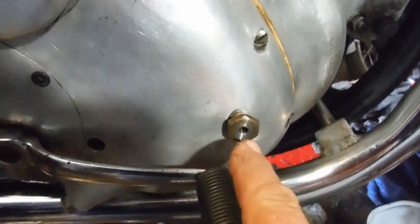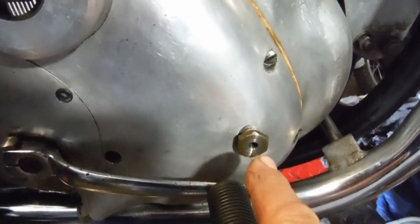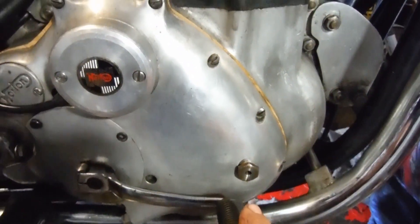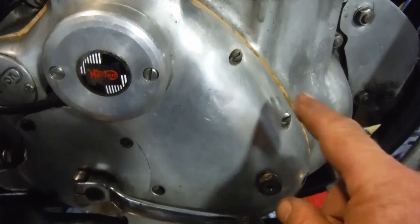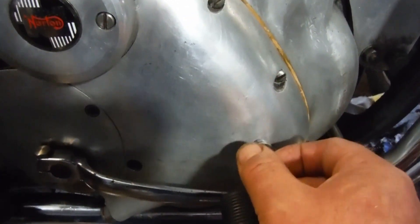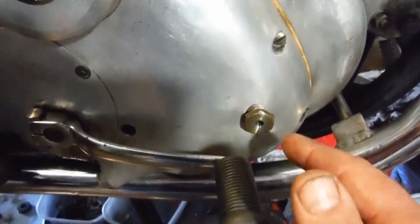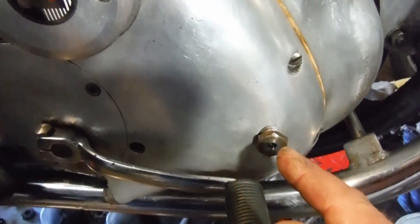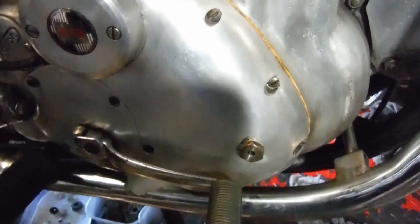Although the center of this hole is concentric with the center of the end feed in the crank, what I did is turn the engine until the crank was up around top dead center, then took the blanking plug out. Initially oil ran out, as the sludge trap or void space in the crank emptied.